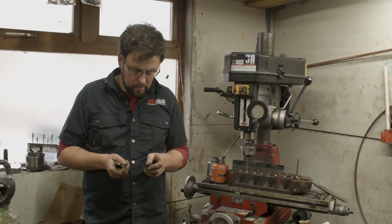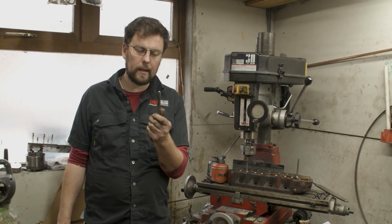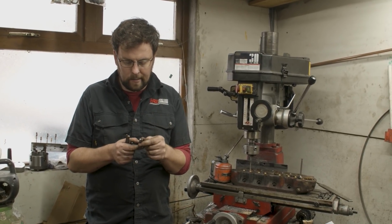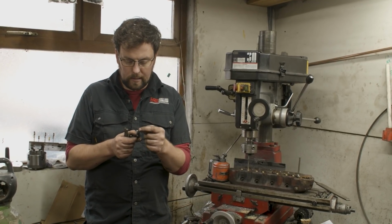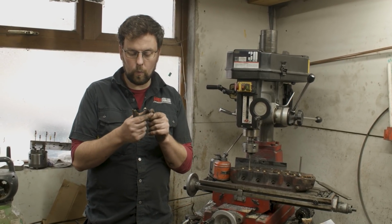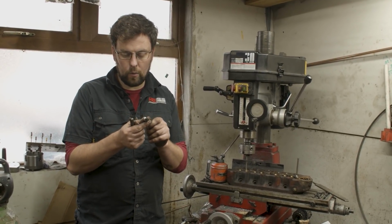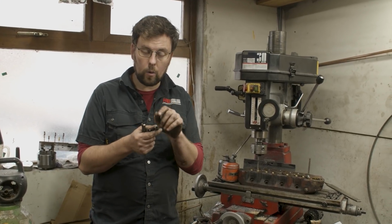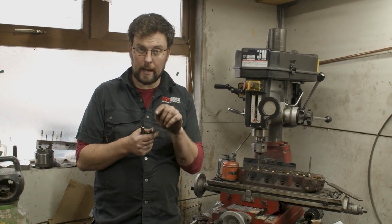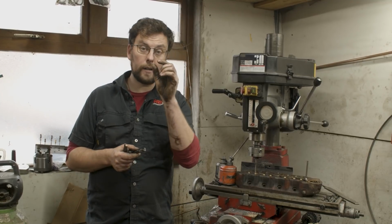Now, what is reaming out? You guys be familiar with drills. This is a twist drill, just picked a bigger one here to make it easy to explain. A twist drill is a means of boring a hole. It's two chisels opposed to each other, twisted around a center. These have cutting faces on either end at the front, and they remove chips of material to make a hole. Because there's only two cutting faces, they do not make a particularly round hole. In fact, they tend to make an oblong hole, or an eye rather than a circle.